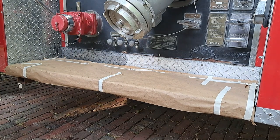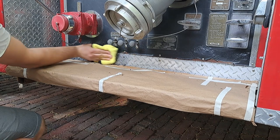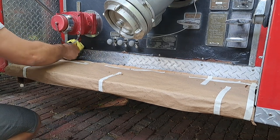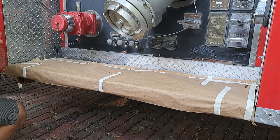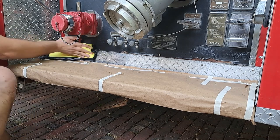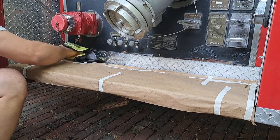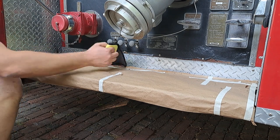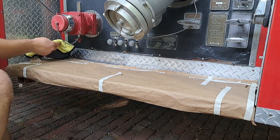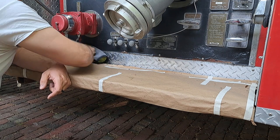After doing the polishing, I get a buffing towel and rub off the polish. Honestly, this turned out pretty good pretty quickly. There's already a reflection starting to form and most of the corrosion on the outside seems to be removed. I found that the trick is to really spend a lot of time doing your final buff. In areas where I have larger surfaces to do, I'll probably get out my DA buffer and put a terrycloth bonnet on it, but this area is so hidden there's almost no way to get a tool down here, so I'm just doing it manually.